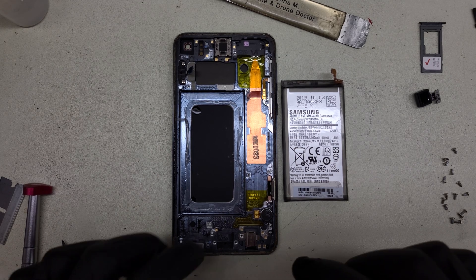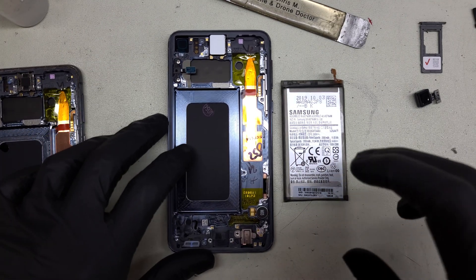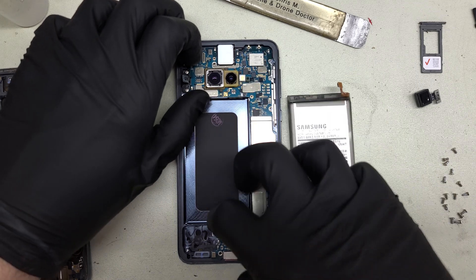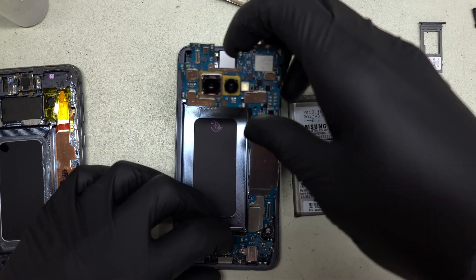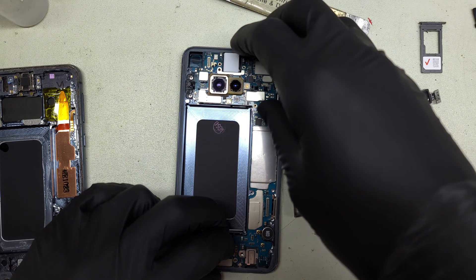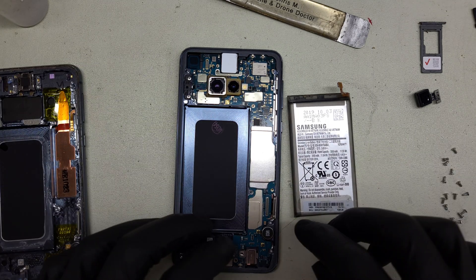In this particular repair, the customer actually does not want the screen replaced and wants only the charging port replaced, mostly due to the cost — S10e screen replacements are about as much to fix as purchasing a new one. But they still want it to work and want a little bit of data off of it. The burn marks were perfectly, perfectly around the proximity assembly. There is no way it was not from the proximity assembly, yet here we are, confused as ever, wondering why on earth this got hot enough to actually burn through an OLED screen.